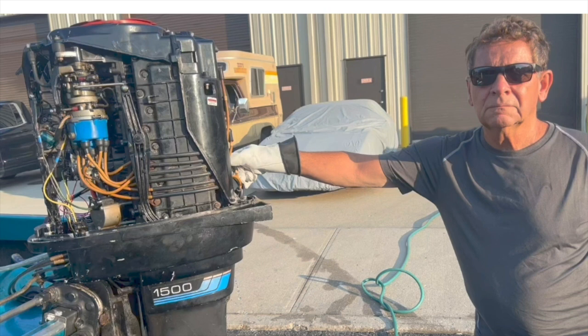Another friend suggested I spray some fuel into the lower carb, but the front support makes it almost impossible to do. So our logic was, if it wasn't getting fuel, it probably would have seized up already. And if it was a lower crank seal, we would see raw fuel coming out the exhaust. At that point, we decided to buy and rebuild another lower carburetor before parting out the engine.